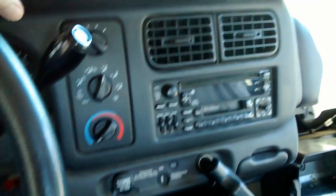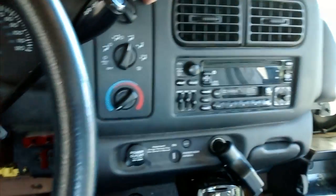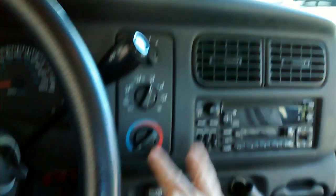On electrical, on the back panel right here, you have to take this guy off. He's got a screw on there. You just unscrew him, and there's 2 next to it. You got to unplug. And then to get it loose, you'll have to undo your trim here, this trim all around here. Just use those trim tools like you can get at Harbor Freight. It just pulls off. There's no screws, and there's 4 screws holding this guy down, 2 up top, 2 down below.